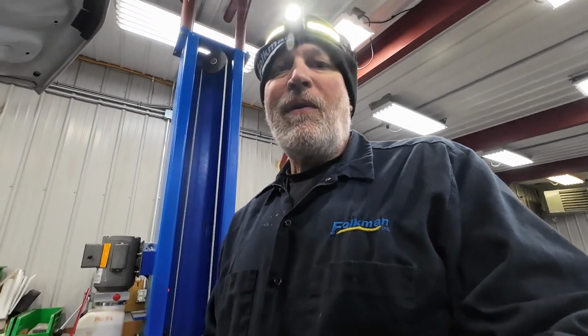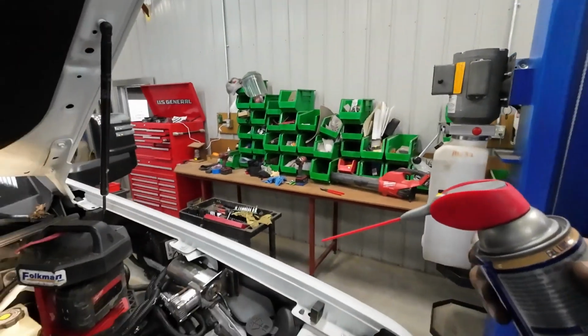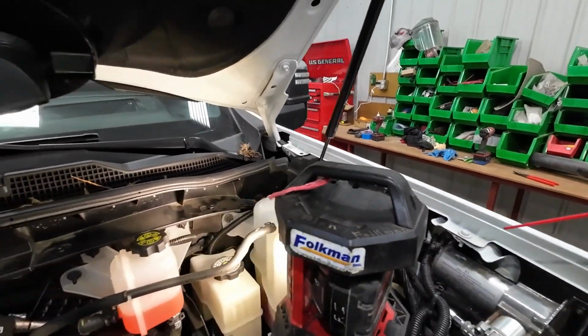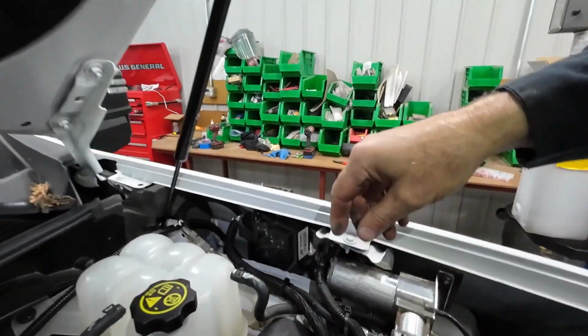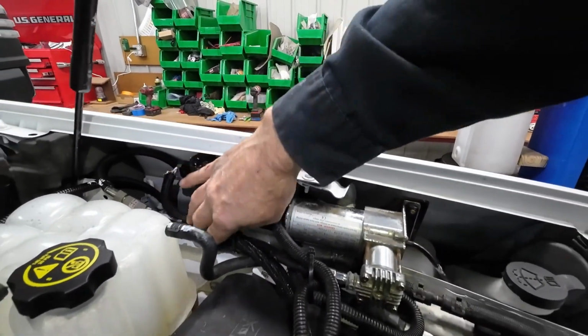When you talk to people, or listen to people doing diagnostics, the first word that comes out is, oh, you got bad grounds, and let me fix the ground on there. Well, fixing the ground is one thing. Preventing the problem to begin with is where you should have started years ago. So what I do is I will go through, and you can see that there's a ground lug for the battery right there.